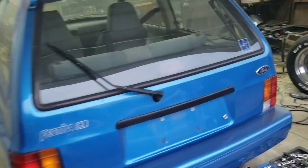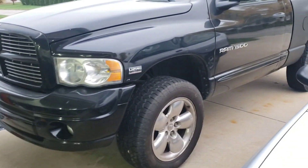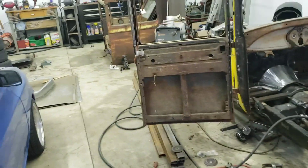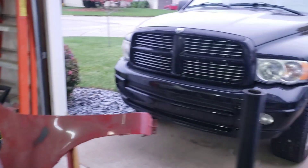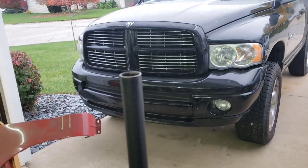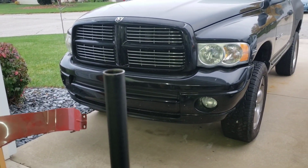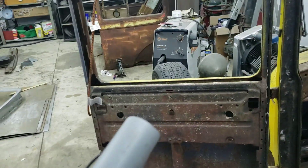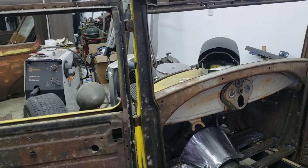Figured I'd give you guys an update with just general shop stuff other than the truck. I haven't really done anything with it other than picked up a few things, and the taillight has a stupid light-out signal thing going on still. The last thing that can be fixed with it is literally tracing the six wires from the taillight all the way to the brake switch in the cab. Typical Dodge issues. I'm going to get off here, get this on, and head out to the car meet for the end of the year. See you guys.